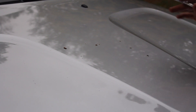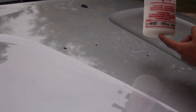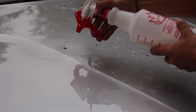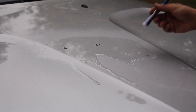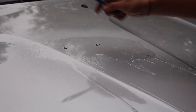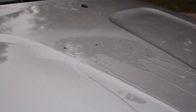The way you take this off safely is first you have to lubricate it so it's all soft, and it'll come up like it's nothing. In here I've got Meguiar's Synthetic Express Spray Wax. Just make sure that everything gets nice and wet. The more wet and lubricated it is, the easier the bird droppings are going to come off. If you don't do this and just try to flake it off, you're going to get scratches. Let this sit and sink into the bird crap and it'll all come out easily afterwards.